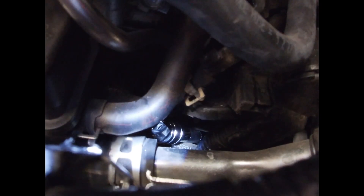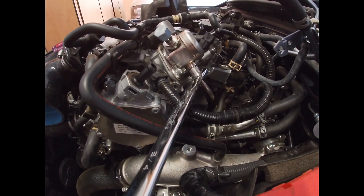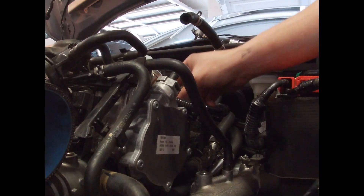Got the bracket off. Next I'm going to go and loosen up the high pressure fuel line — I believe it's a 19 millimeter, but my three-quarter works perfectly with no slack. Now because these are fuel lines, there may be a little bit of fuel that does come out, so you have been warned.